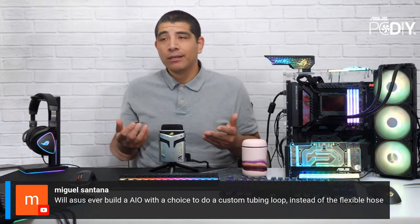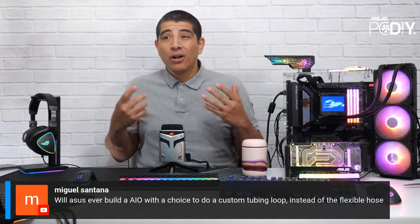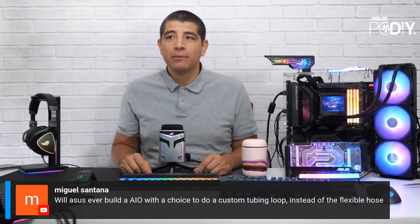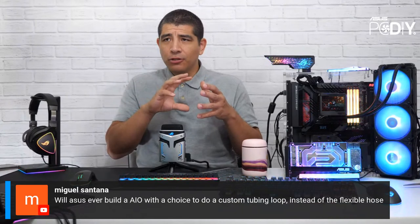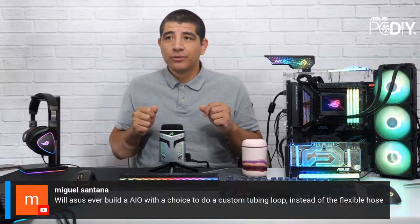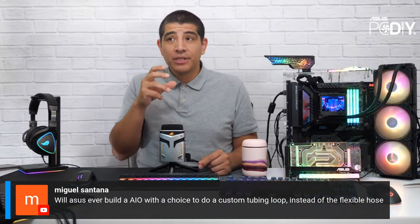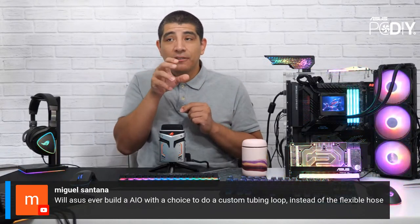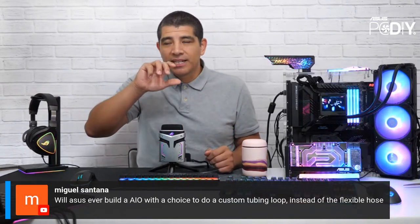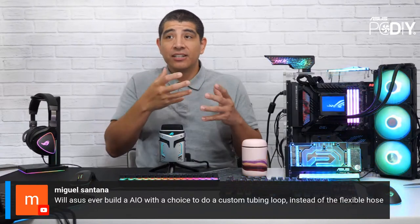Now, does this mean that you couldn't do it? Of course not, because in custom water cooling, this is what users do. You put together your own fittings, and you get it all set up. Although, I can tell you, one of the things that a lot of videos or guides or people that talk about water cooling always fail to mention is that there's a little bit of variable resistance that happens when you torque your fittings, and they'll become a little bit loose. If you wait about a day or 2 days, sometimes it can take up to a week, it just depends, but you find that they can get a little bit loose. And so generally you always want to go back after a few days and retighten it up a little bit. You don't want to over-torque it too much where you could damage it or cause a little bit of kinking to your tubing if you're using soft tubing.